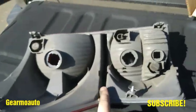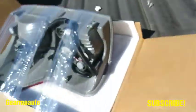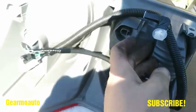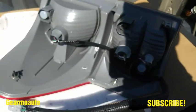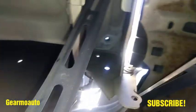Now I'm going to go get the wire harness out of here. This runs below the vehicle. Like I said, this one comes with it. It looks like this goes underneath the vehicle to a connector somewhere like that. So I'm just going to go disconnect it from wherever it's connected to. The wire harness goes underneath here. Crawl underneath. Hopefully you're not wearing a white shirt, a nice white shirt. Here's the connector right here. It's mounted on this little wall right here. So go ahead and disconnect this connector.